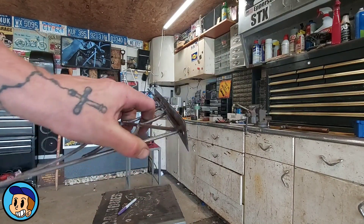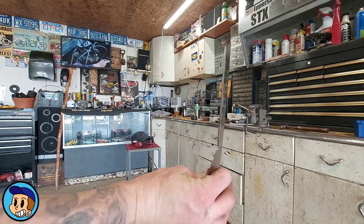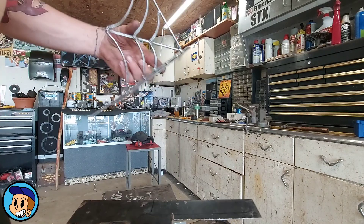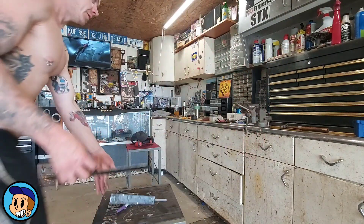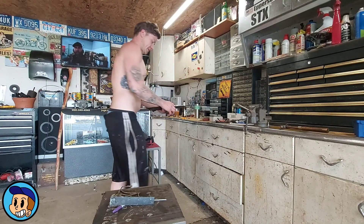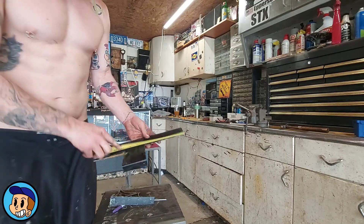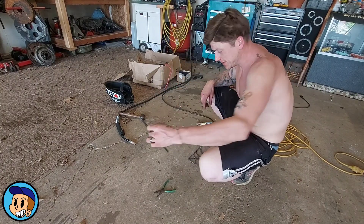As for my backer plate, I'm literally just using leftover pieces of metal that were already left over from my F-100's floorboards, and I just used this one as a stencil. If you need the dimensions, it's 1.5 inches by 8.25 inches. I cut my random piece and put two holes in it.